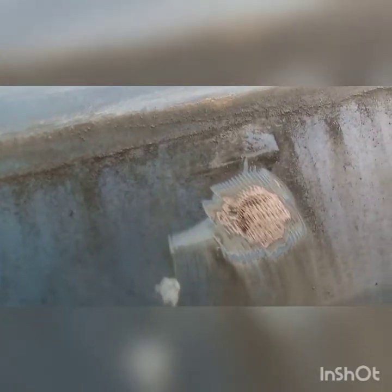Because when that metal gets hot, it's going to bond with this other metal. And what you got is a smooth surface. All I have to do now is come back with some 80 grit, something like that, and then come up to some 320 or something, and we'll make this metal smooth with no holes in it. That's what I'm hoping. I hope it works like this all the way down through here. I'm not sure, but I hope it does. But this is where we are. I just want to get y'all some footage of that so y'all can see what's going on. We'll holler back.